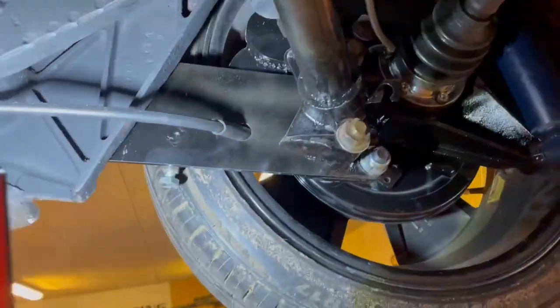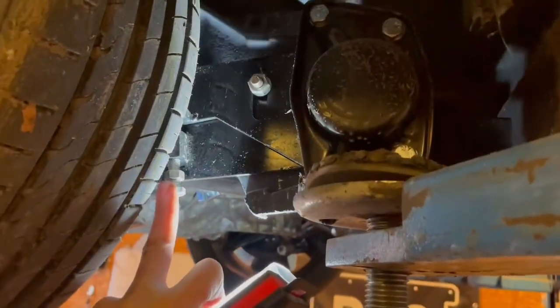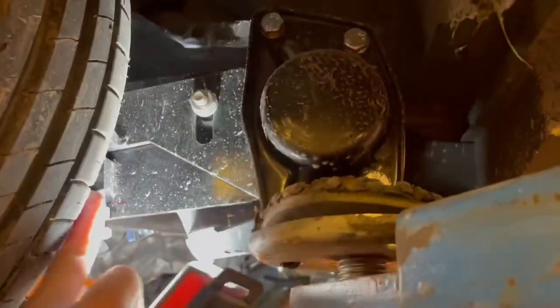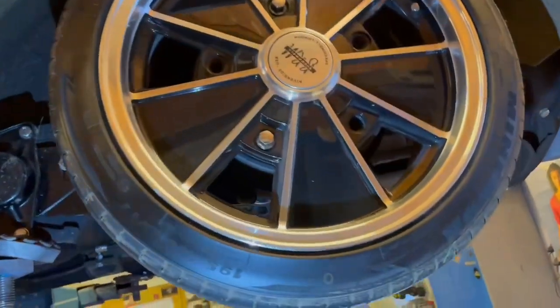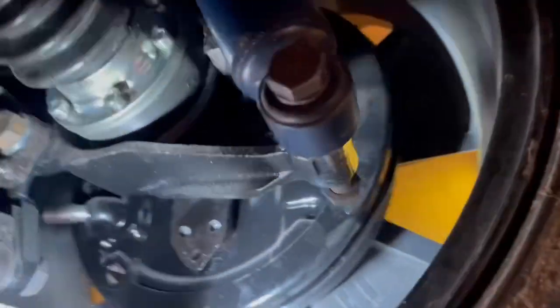First things first, I really like the adjustable spring plates. You can buy them from all different brands and adjust your height just with the screw — that's one benefit. Another benefit is if you just lower it the wheel will be angled, and it's almost impossible to get off without taking air out or using a crowbar to push the wheel down. With the adjustable spring plates, the wheel kind of just falls down on its own when you're taking off the shock.